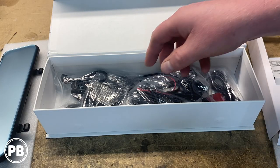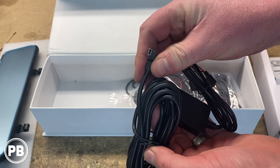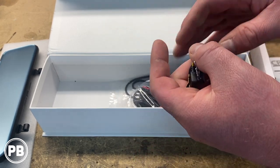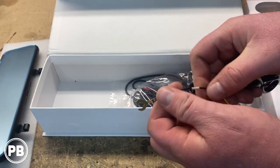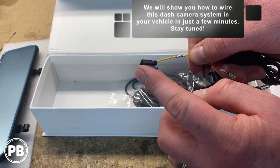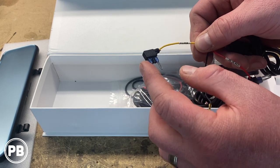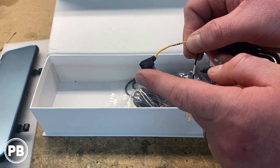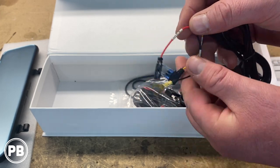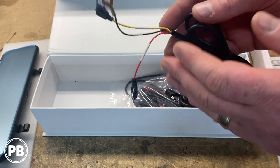Further deep in the box we have our accessories. Starting here, we have our power harness. This power harness is really simple to set up — this end goes to the mirror, and we already showed you that port on top of the mirror where that plugs into. On this end you have three connections, similar to an aftermarket radio: you're going to have a ground, which you just need to connect somewhere in the vehicle that's clean of paint. We have a constant or battery wire that needs to go to your fuse box on a circuit that's always on regardless of the key — it will replace that existing fuse and plug in at that place. And then finally the red one is your accessory, a circuit that's only on when the key is on. When we get this set up, we'll show you how to test for those things to identify where these would go in your own vehicle.